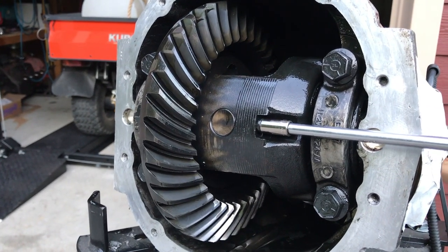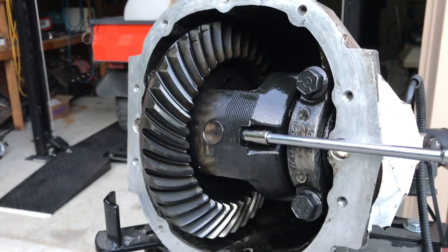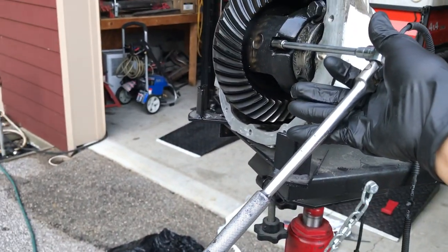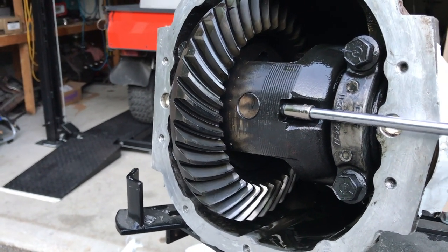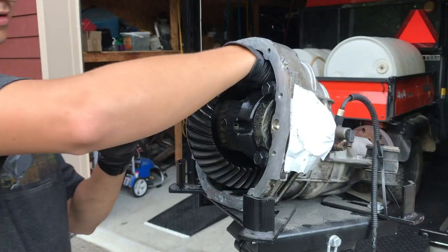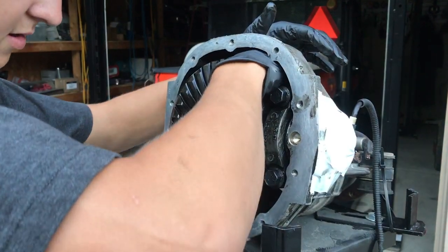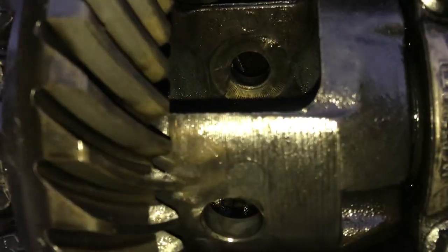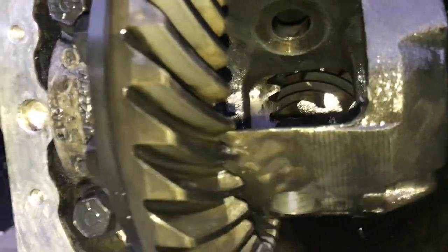What we're doing here is taking the locking bolt out of the pin and we're going to start rebuilding this differential with new clutches. I've got it rigged with some help so that it'll hold, since it's not in the car. It's a 5/16th bolt, not an 8-millimeter like I thought. Use a semi-long ratcheting wrench and slowly work that bolt out. Be careful — if you round the head off the bolt, you're kind of screwed. Once you've removed the locking bolt, reach behind the differential and push the locking pin out. If it's rubbing against the S-spring, push on the S-spring until it releases and it should slide right out. To get the S-spring out, tap it out with a piece of wood, then grab a vice grip and yank it out. To get the spider gears out, hold the ring and pinion to make sure they don't spin, and then slowly turn the spider gears so they can come right out.